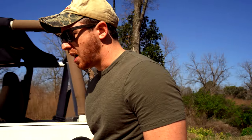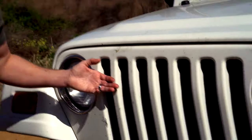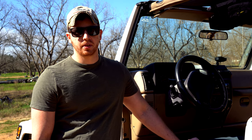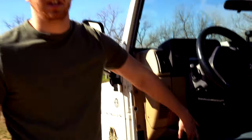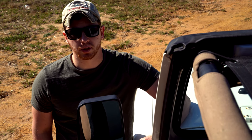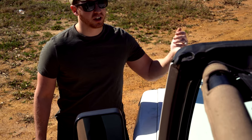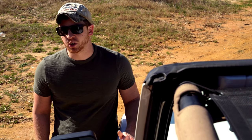Now we're going to work our way back to the front of the vehicle to the traditional seven-slotted grill. When it comes to rust inside the cab, you're mostly just going to want to look at the floorboards. Water likes to travel down with gravity, so pull up the carpet and look for a nice clean floorboard like this. If it has bed liner on the inside, they might be trying to hide rust - so bring out your knife and double check. Keep an eye out for LED lights drilled into the body. People will just screw them in without prepping the body - on the A-pillar, on the hood. Those screw holes will create rust, those LEDs will fail, and when you pull the LED out you're going to have ugly holes with rust in them, making the Jeep look cheap and devalued.